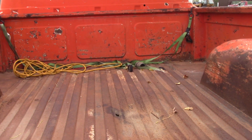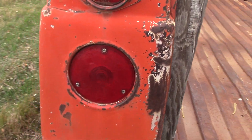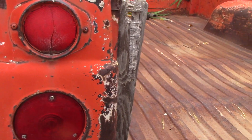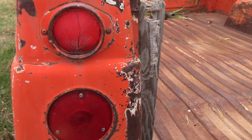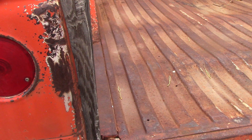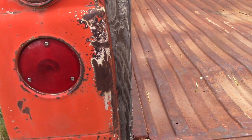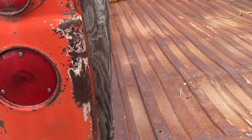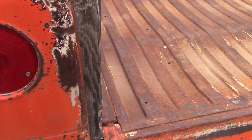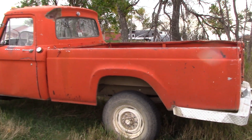I don't know if the rust has something to do with water sitting there and the muffler underneath — the heat making it rust a little faster. The rear lights: I put new lenses in it, rewired the tail lights and turn signals, because the wiring was actually cut right behind the cab. I had to rerun everything from scratch to the back, which was a little painful finding the wiring diagram. But they work now — I have working stop lamps and turn signals.